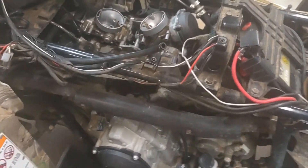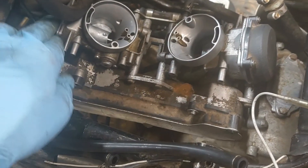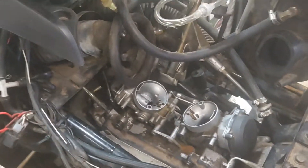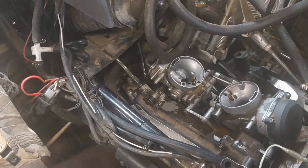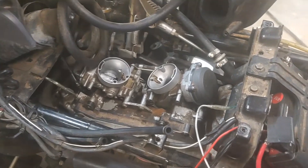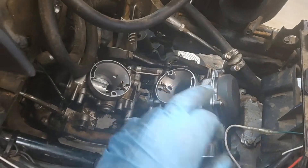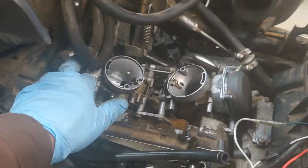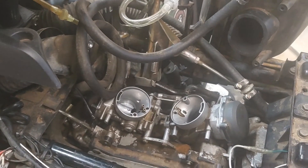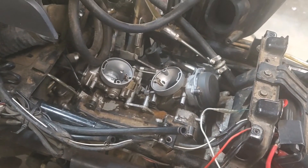Got the choke off. Both of the diaphragms look like they're moving up and down good - that means you've got a good seal on both of your top covers. It'll probably run a little rough with the airbox off, but I'll stick the airbox on there and see how it does. As you can see, both of the diaphragms are bouncing up and down - that means they're working. It's kind of cutting back just a little bit, but it usually does that when you have the airbox off.